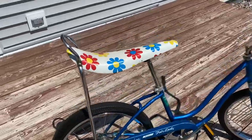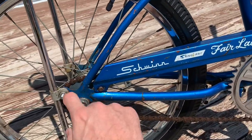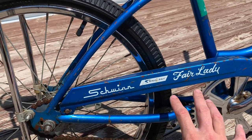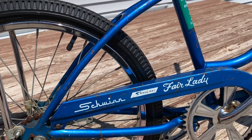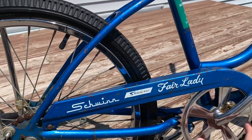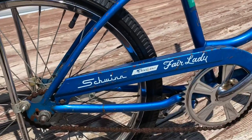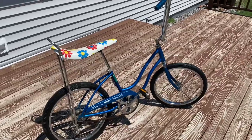One other quick thing — if you notice on this particular bike, the back sprocket is pretty large and you've got a good-sized front sprocket too. That's going to give you a nice low and top-end combination. The closer you can get your two sprockets to the same size, the nicer the average ride. A big sprocket in the back and a little one up front — or vice versa — gives you either better top end or better low riding speed, but this setup gives a nice average ride-around-town combination.